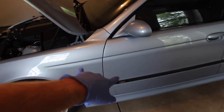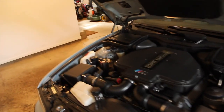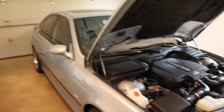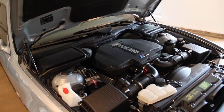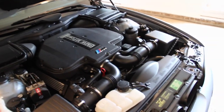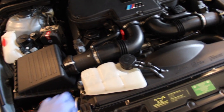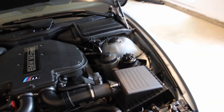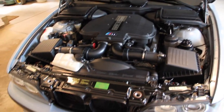I've actually replaced that cable before, but it's been six years and it's been opened hundreds of times since then. This DIY is really for people who are way too involved in their cars and have opened their hood more times than their driver's door. The reason I'm replacing these cables is I've noticed that when I pull the hood latch inside the car, I have to pull it a lot further than I used to. The cables are a braided steel Bowden cable inside a rubber or plastic sleeve — those cables stretch and can fray.